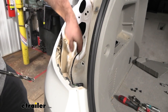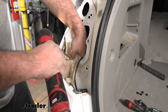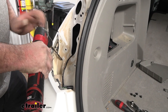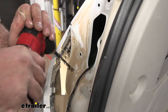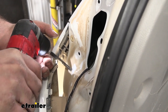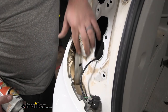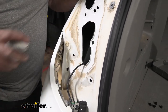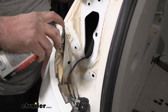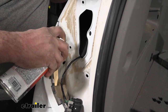I'm just going to find a spot where I know there's no wiring behind there, and just drilling this out is going to allow us to pass the wire through and still maintain that seal. I'll go ahead right about here and drill through our metal. Go ahead and clean off any of those burrs that might be left. I'm going to put a little bit of clear coat here just because it's going to be raw metal — we don't want this to turn to rust long-term.